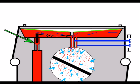This is a diaphragm with the correct plunger. You can see there the plunger's longer and there's more flow through allowed there through that spacing. So there'll be enough fuel supply there for the engine. Comparing that scenario again there with the shorter plunger, we can see a big difference there. There'll be less fuel available.